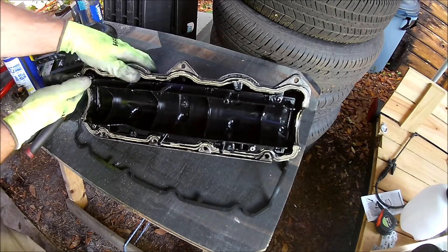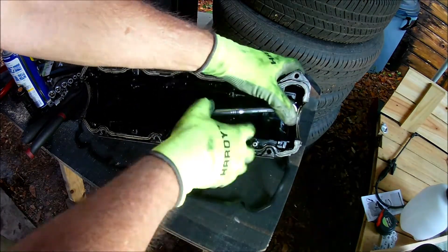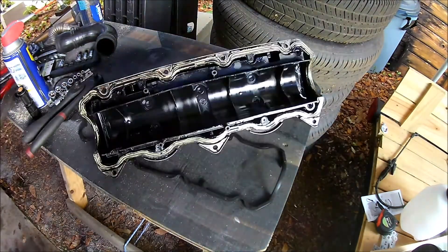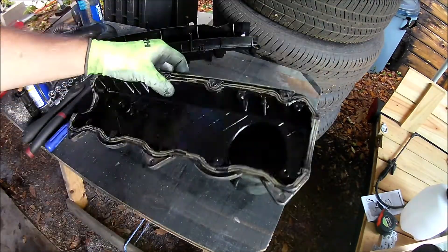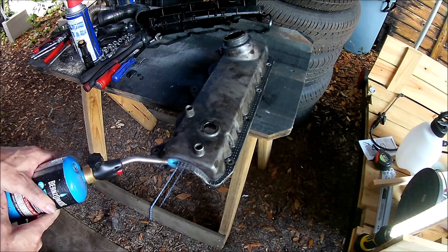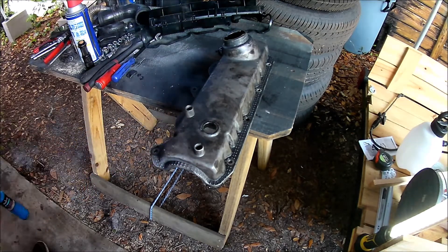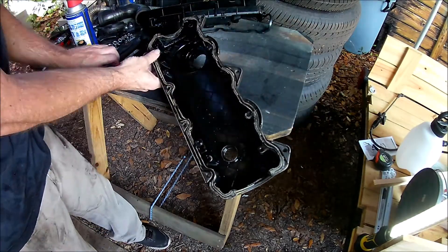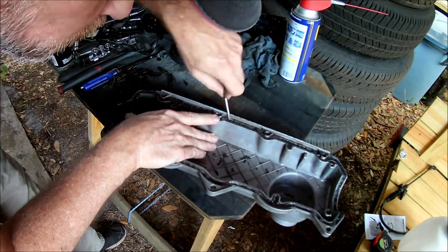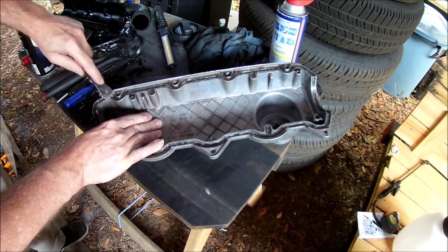I need to remove that old gasket. But before I do that, I'm going to remove the plastic and rubber parts from the valve cover — I don't want to risk damaging them. I'm using a propane torch to soften up the gasket, which hopefully will make it easier to remove. A heat gun would probably work too. I was able to pry out most of it with a big screwdriver, but I needed a pick and a small screwdriver to get the rest, then scrubbed it with a wire brush. I won't lie — it was pretty tedious.